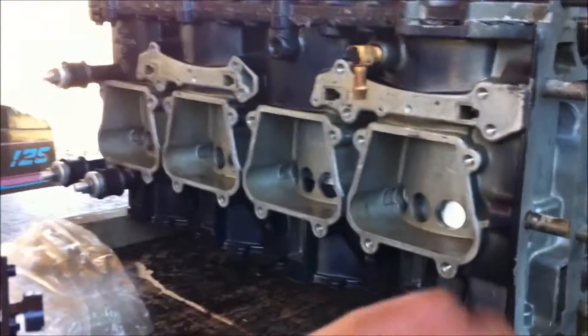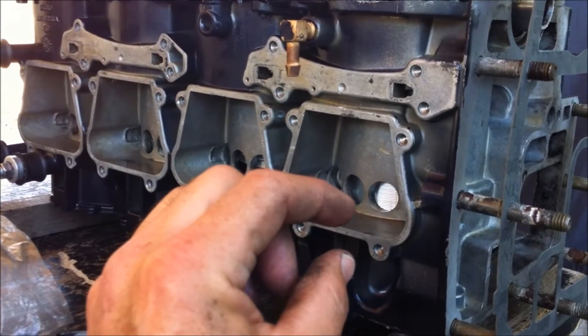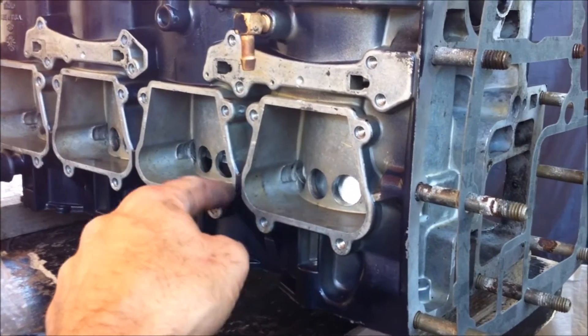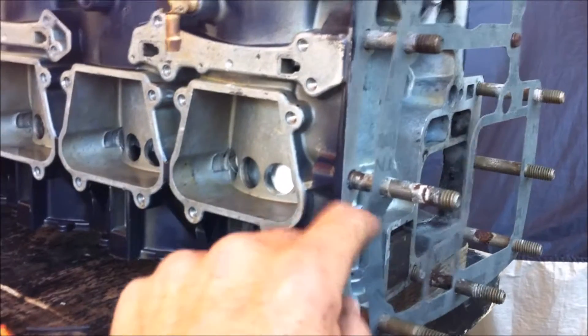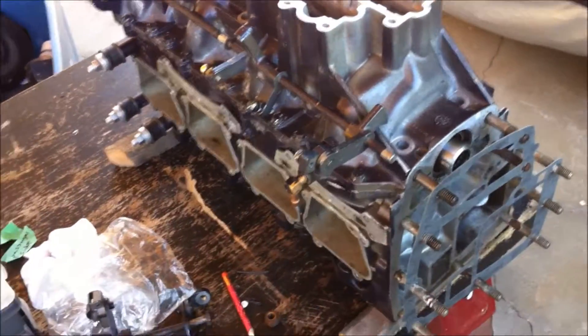I'm just fitting my gasket on here. I should mention that all my surfaces — you notice I cleaned them up pretty well. A friend had this little round attachment that had kind of like hard plastic bristles that spun on his pneumatic gun at high RPM. All those little fingers cleared off and cleaned all my gasket surfaces, including the crankcase and the cylinder head surfaces. It saved a lot of time. For cleaning gasket surfaces it's an air tool attachment — basically a bunch of plastic bristles on a circle about that size that you attach to a high-RPM air tool.